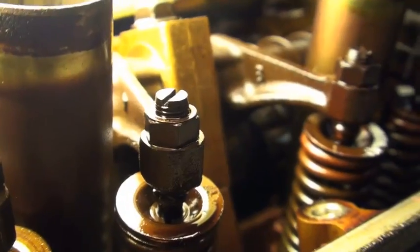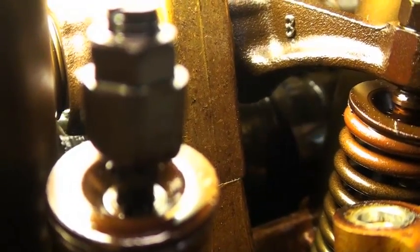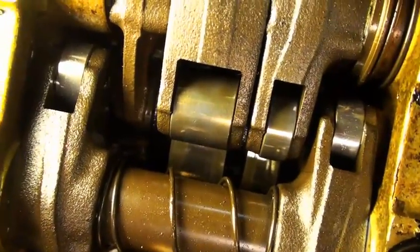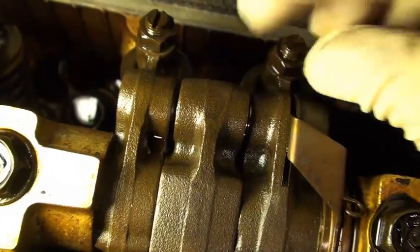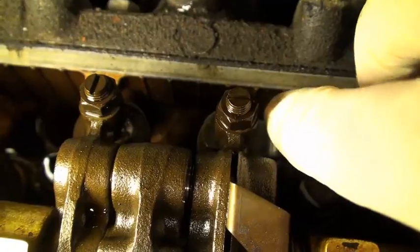I'm going to give you a close-up and show you what we're looking for. See the camshaft moving? Right there is the cam lobe. You want it to be exactly on the opposite side of the rocker arm — 180 degrees pointed the other way. That means you will have slack at these rocker arms. This is the intake side. Where you put your feeler gauge is in between the rocker arm and the top of the valve stem — directly underneath the rocker arm and just above the valve stem itself. That is where the feeler gauge goes.